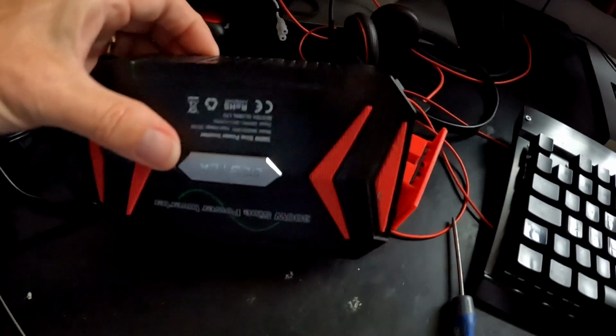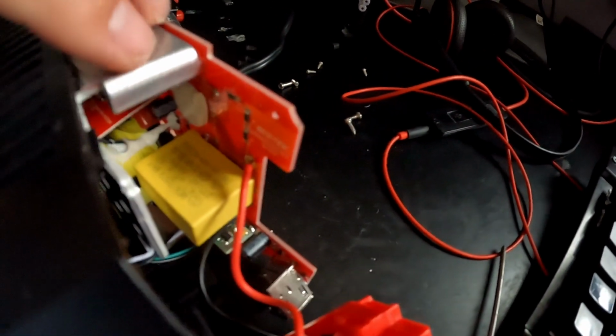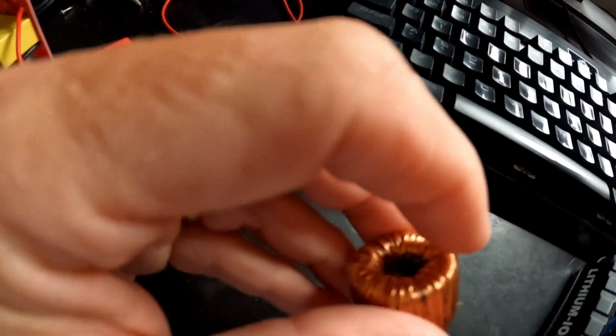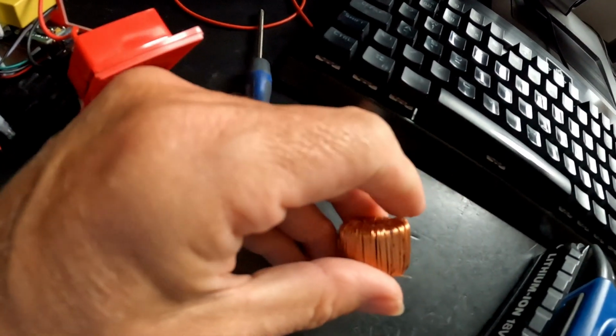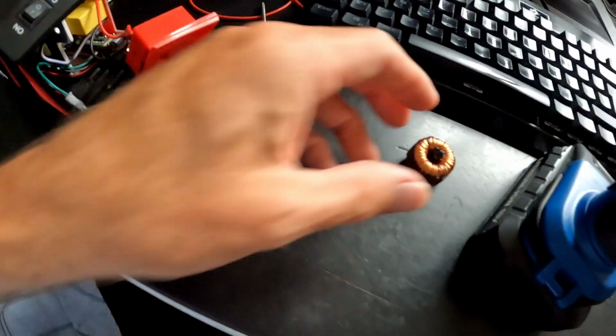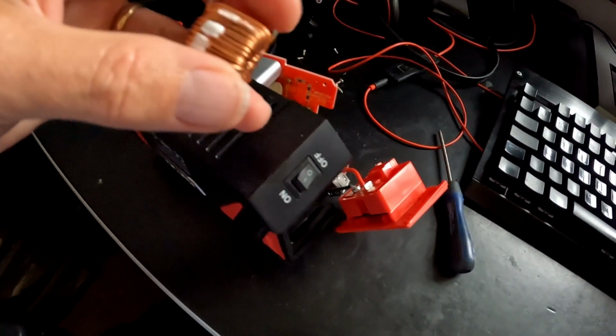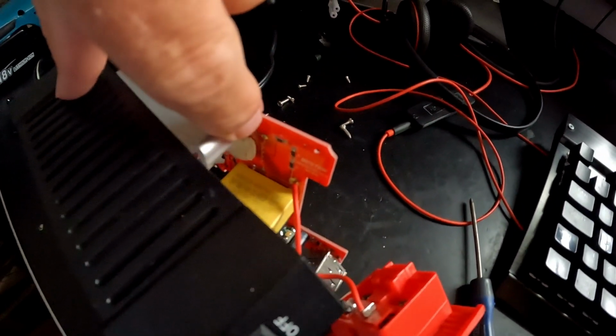The latest favourite is, when Bestech built this, they have this big inductor in there, and it was just held down by double-sided sticky tape here, and of course over time that's failed, and then the whole weight is held on these very small varnished wires. Of course, once you move it and knock it about, this just breaks off entirely. So I'm going to look at soldering that back on, but obviously I've lost the end bits of the wires, so I can solder some lengths of wire on and then take them back to the PCB.